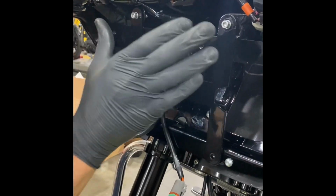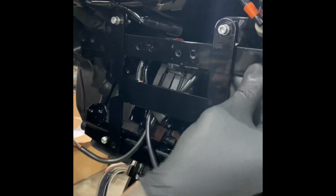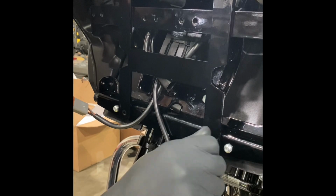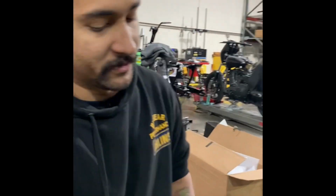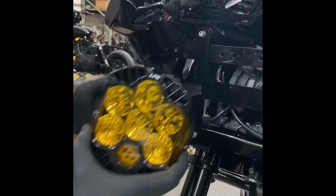Next step is your H bracket with the long flat bar towards the rear. Leave you more room for your L brackets here. It doesn't offset it. Use the screws that came out of your stock light. Should bolt right up, and you can torque it down because it's not coming out again. Easy enough.